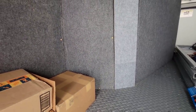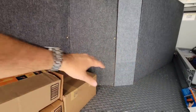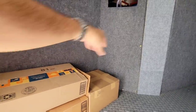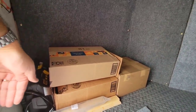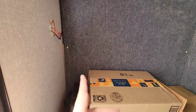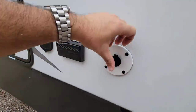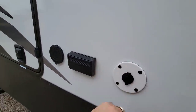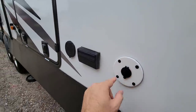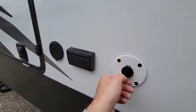This has been really fun because it was interesting being able to explore where there was essentially unused space. I found out that everything behind this wall up to about here, which was closed off, was all unused space. If you didn't catch that video, I installed a 12-volt cigarette-style plug right here. I relocated the spray port, which was right there, to right here. The reason I put it here was to cover up the hole, and it also gave me a very useful powering option outside.